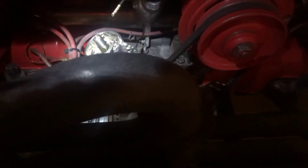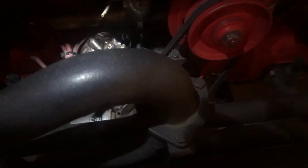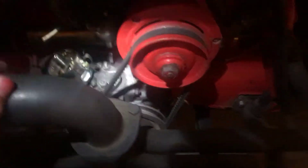If you're on the road and you get messed up, a matchbook cover will also be about 16 to 17. Once you have that set, fire up the motor and adjust your carb just where it idles once it's running.